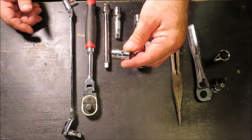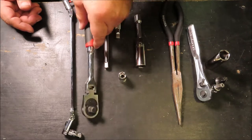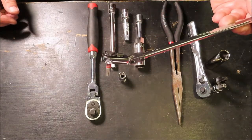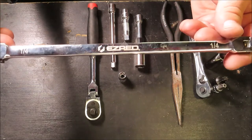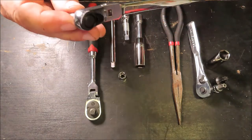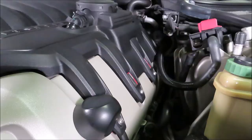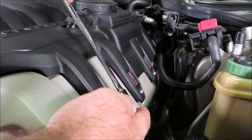You're also going to need this, an external Torx, something new, another 3/8 ratchet. When you do the torque tube, you're going to need both at the same time, and this tool here, which makes everything extremely easy. You're going to need a Torx 30 to get the covers off, but this is an Easy Red 1/4 inch ratchet. One side has the 1/4 inch ratcheting end and the other side takes the bits, and it's magnetic. This tool, because of the low profile, made the job extremely easy compared to the first time I did it. I'll go ahead and leave a link in the description with the part number for the Easy Red and the Bosch plugs as well.